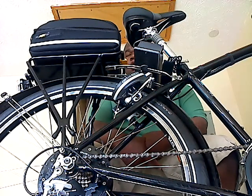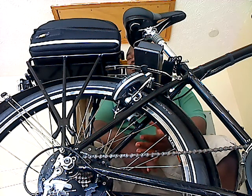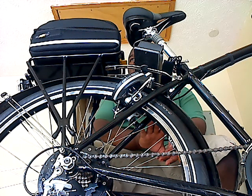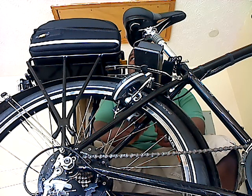But basically, the motor does spin up and I can ride around on it, but if I accelerate too hard, the controller loses sync, or if I encounter a hill or something, like if I'm accelerating up my driveway, the controller loses sync. It always happens when I roll into it, or basically, you know how you have that amperage spike when you're accelerating. It always happens at the beginning. It never happens whenever I'm at full speed or anything like that.